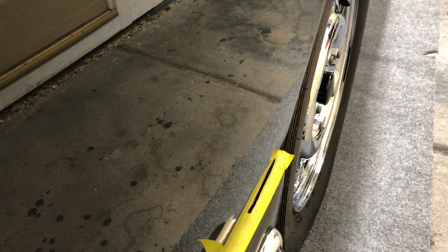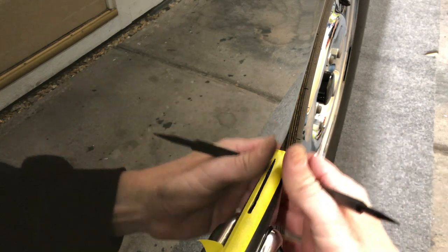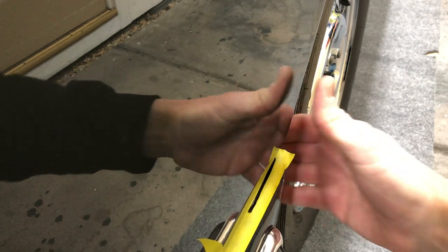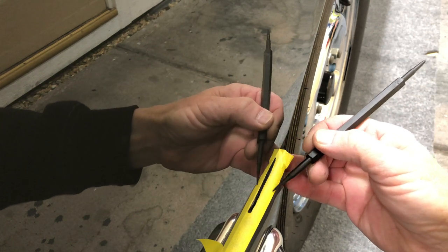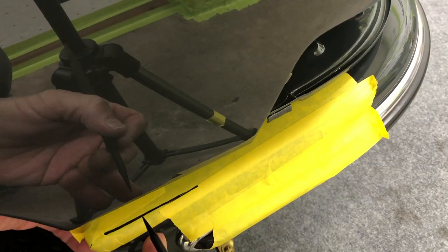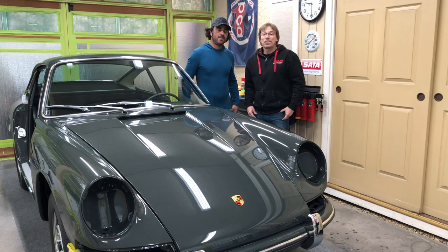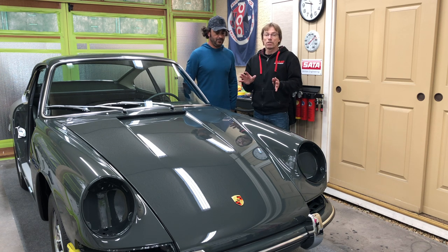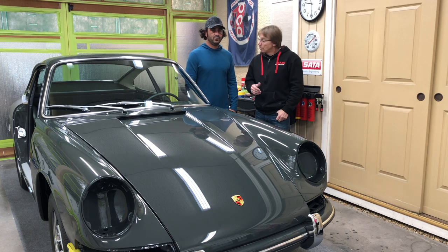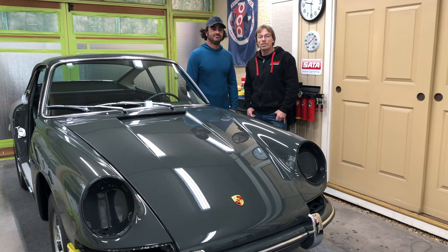So we ended up tearing it all down just one last time to make one final adjustment to get everything a little bit more right. You can see our line — what's going to happen when we pull up and clamp to the bumper — the detail is going to be flush from our fender starting at our bullnose, and that's going to be the case on both sides. Once we draw everything up with our fender-to-bumper bolt, that should align up nicely. That's going to do it for this one — a little bit involved putting that bumper on there. You definitely need an extra pair of hands and a full mock-up, possibly a couple of go-arounds on the mock-up. With these cars, if everything isn't exactly where it's got to be, it's definitely not going to fit. Mike, thanks a lot — you're a hero. We're going to get over there and check out Mike's Mustang, so look for that one coming. Thanks for watching, and we'll see you on the next video.